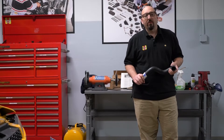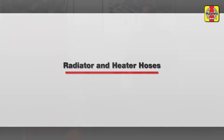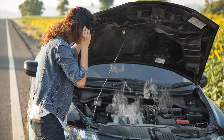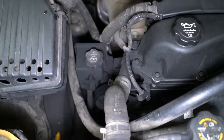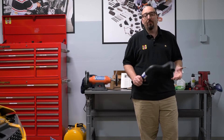Probably the most important hoses under your hood are the ones that transfer coolant from the engine to the radiator. Since coolant is very hot — between 200 and 240 degrees in normal driving — and under pressure, these hoses are prone to failure. Failure in one of these hoses will definitely ruin your day. To avoid the tow truck and that missed meeting, check the radiator and smaller diameter heater hoses on a regular basis, but it's easy when we show you how.